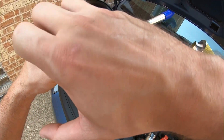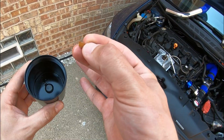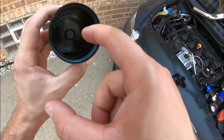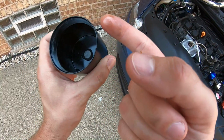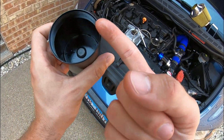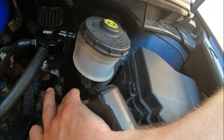There's something in the catch can — looks rubberized, maybe something from the catch can itself. There's just a tiny bit of oil — it's like watered-down oil, moisture buildup or condensation — but nothing really significant. Not bad at all for 500 miles of heavy driving to accumulate almost nothing. We'll clean it up and reinstall it. You can see the little baffles in there — so it's working as expected.